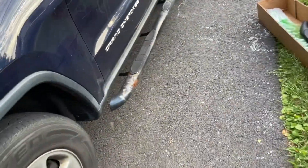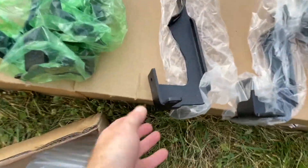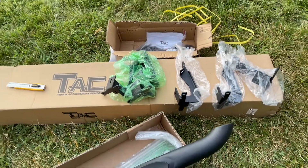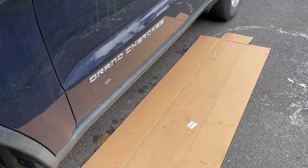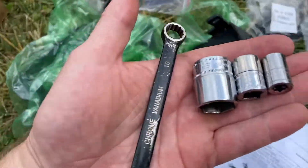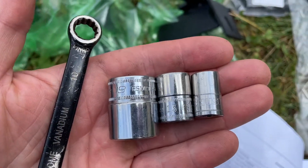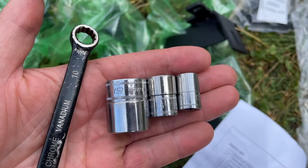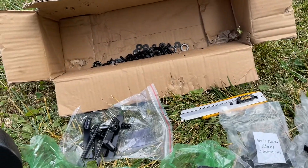So I'm going to pop these guys off and show you how to install a new one. The brackets and everything also have a textured finish, heavy-duty screws and directions. For the install, all you're going to need is a 10mm wrench, a 10mm socket, a 13mm socket, and a 19mm socket for the three types of bolts that come with this kit.